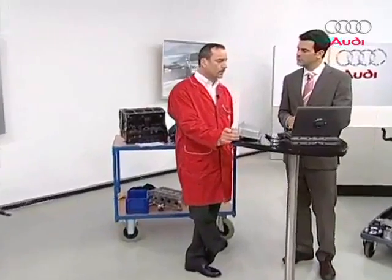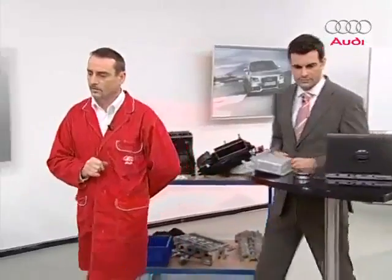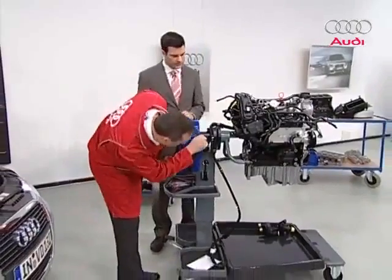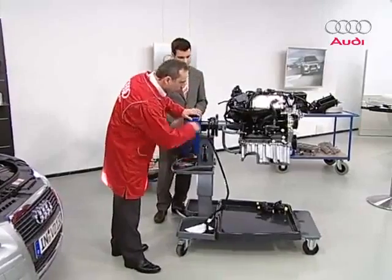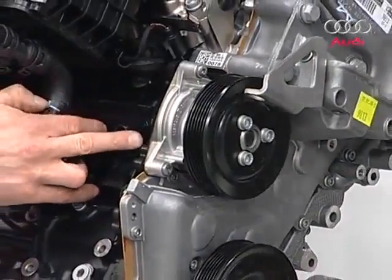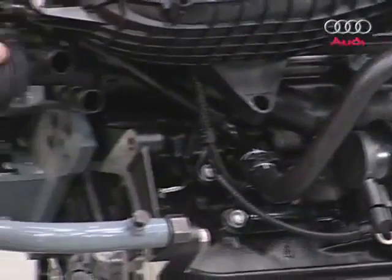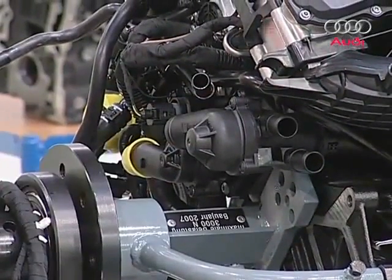Harold Apple asks: how is the water pump powered? The water pump is driven by the ribbed V-belt. Let's go back to the engine. The water pump is on this side of the V-belt drive, fastened to the block. If we follow this fairly long plastic tube, we end up at the thermostat unit.